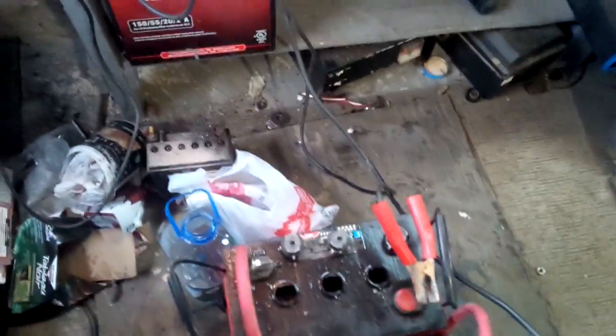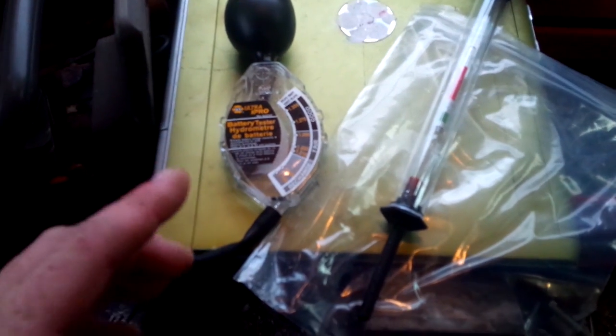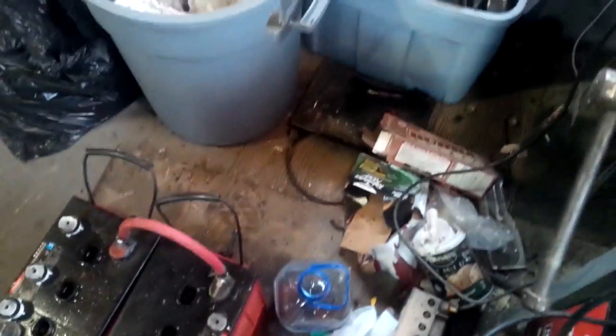The easiest way to get your specific gravity up is to find yourself a charger and charge it up — there are many different charging methods and techniques, that's a whole other story. But if you're getting into this, I'd avoid these bulb-style testers. They do work but they're not as accurate and I don't trust them as much. This tube inside may look familiar if you've ever made beer, wine, or alcohol — something like this one over here, which is actually for that exact purpose. It has potential alcohol by volume and specific gravity markings.